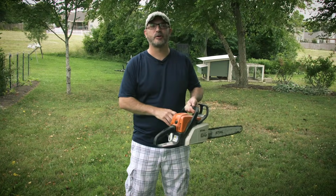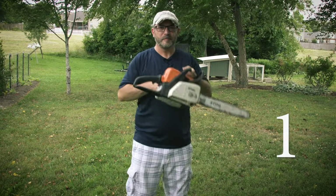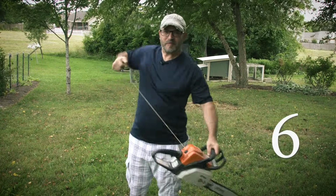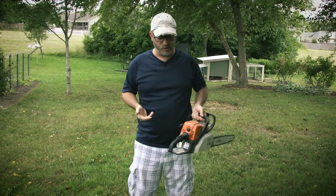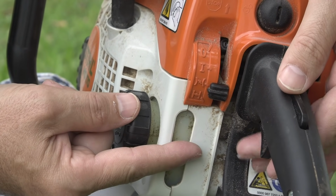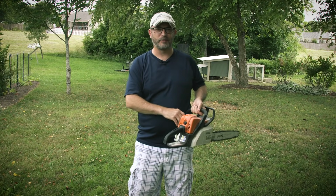All right, here it goes. I'm gonna pull until it burps. Okay, so it took me 4 pulls for it to burp. You heard it burp. So I'm gonna flip it 1 notch up to the number 3 position, which is like half choke, and I'm gonna pull it and it will start.